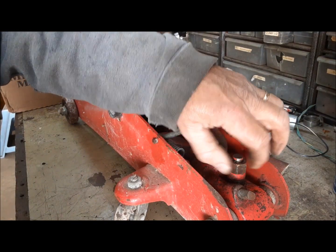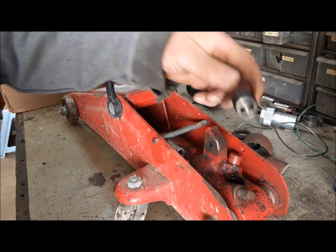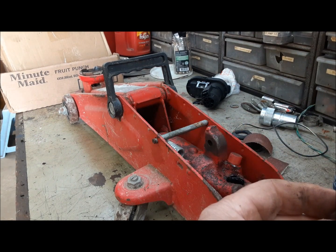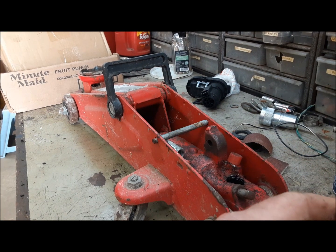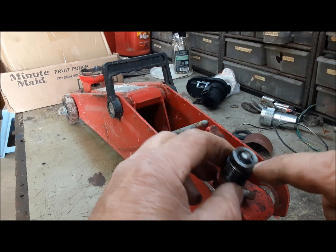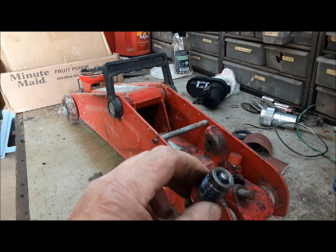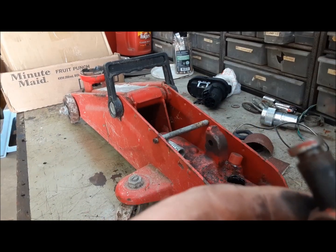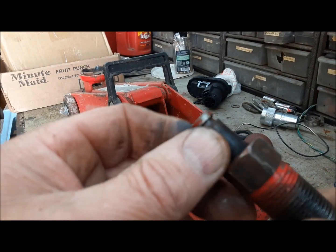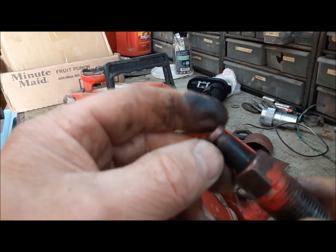It's just a big pipe thread. We'll get it in the vise and tap down on the piston ever so gently to see if we can free this thing up — we can't put heat to it because that's the plunger cup and we don't want to hurt that. That was easy as pie. You can see all the corrosion on there, but down in the actual bore where the oil is, there's no rust at all, so that's fine. We'll get it buffed up and slowly work it back and forth until we've got it moving freely.